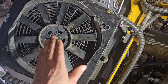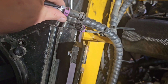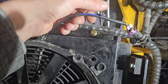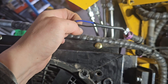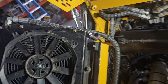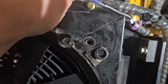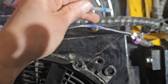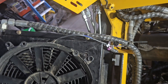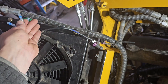I fired it up and obviously it's blowing into the unit. Right here basically what we have is the plug - this is positive and so on. So what I'm going to do is put the blue to the black after the module, and that should make the blade go the other direction. What I'm going to use here - my brother swears by these - are these splicing connectors. You splice this, get your thread, heat it up, and it basically solders the stuff together. Once you swap these two lines over it should blow the other direction.